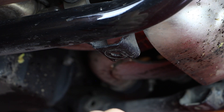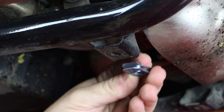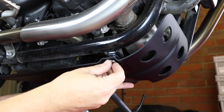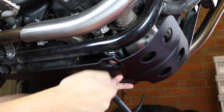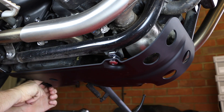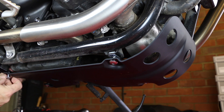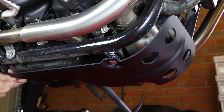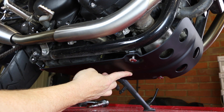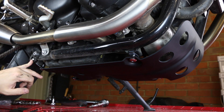Shame on me for not cleaning my bike before I did this fitting. The last job in this kit: you have these two little captive nut plates that just slide into place on these front frame rails, and then it's simply a case of taking your bash plate and bolting it in place. At the back, the bracket you've already fitted is your reference point for the rear, and the one you left loose you can move around to get it where it needs to be. Once you've got all of these into place you can tighten that rear one up and get that all secure — and that's your bash plate done. Just for reference, the bolts holding the bash plate on need to be done up to 6 Newton meters, and the side one here 12 Newton meters.